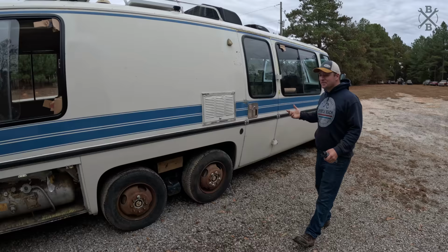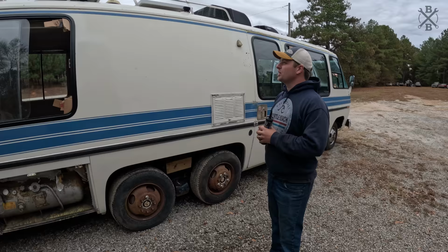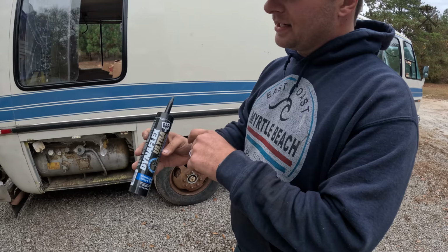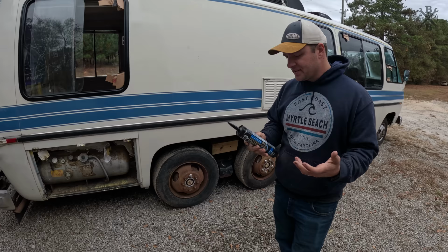Seals in, we can go ahead and put a small strip of silicone around the outside of the window, which is just going to go ahead and completely seal everything in, and we should be completely watertight at that point. Now, doing some research, talking to some folks, what is highly suggested here is this DAP Products Dynaflex Ultra, and we just got it in black. This stuff is paintable.